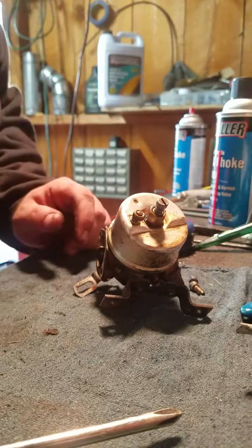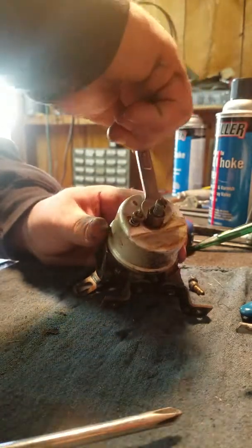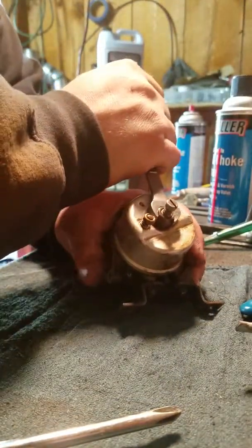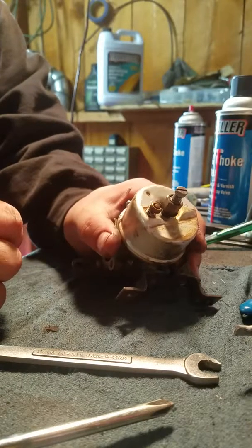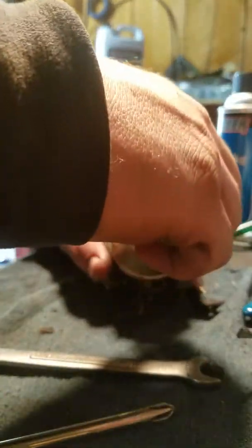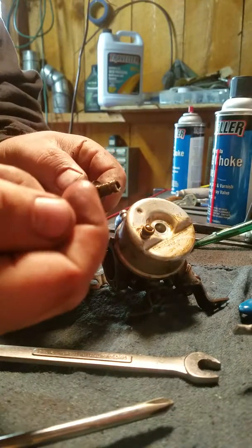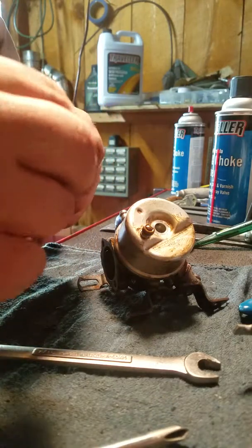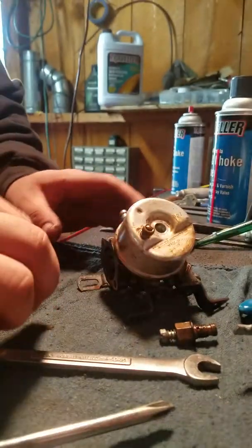Makes you wonder why you touch it with your bare hands. I'm going to pull this off — 7/16 I believe. Yep, break that free. Nice gunk holding it in place, on there pretty tight, and it's going to fight me all the way off because it's got a lot of nasty gunk. This spring here is a drain — if you have a little bit of water in there you can just hit this and drain out a little bit of gas. Yeah, look at that thing — I think it had some water in it at one point. The jet's not looking too hot for this main one.